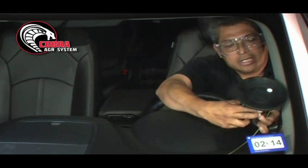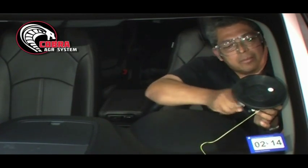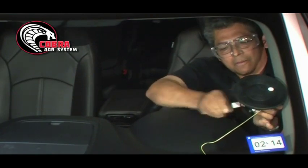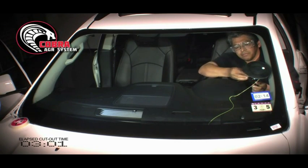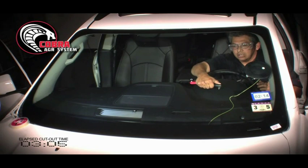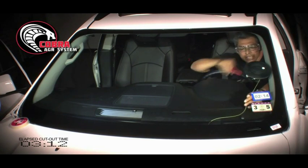So I'm going to turn it here facing the corner, and as I can see that the cord is okay, I'm not going to be putting it under a bind on the tool on itself. Again, I'm going to pump it up until the red line disappears on the plunger itself here. Get my ratchet, there's a push button on the ratchet. I'm going to push it in, it falls in place, and I start to cut again.